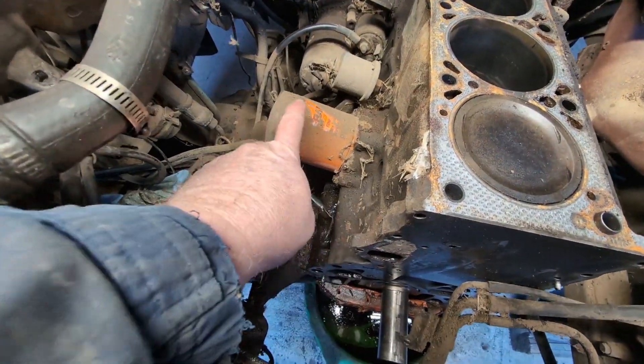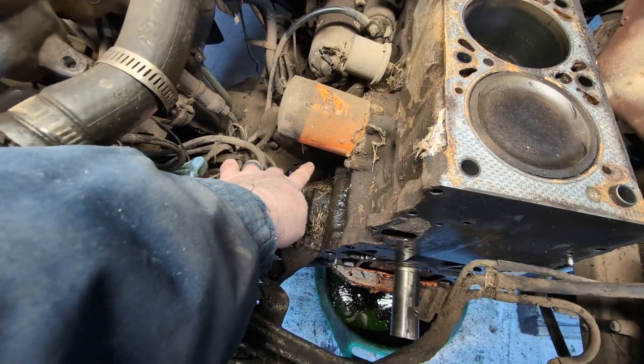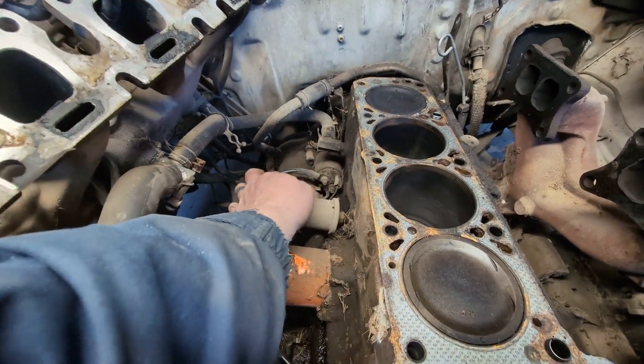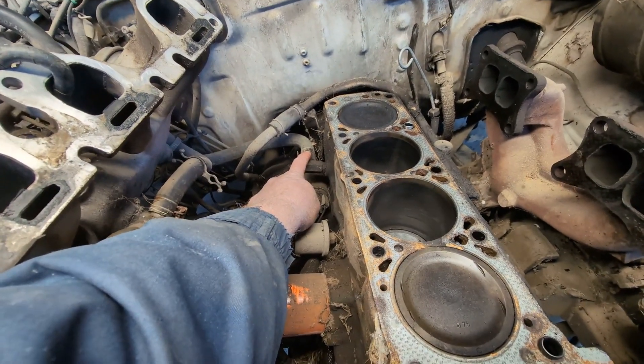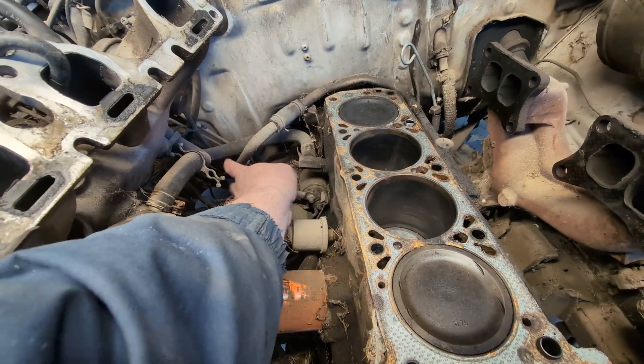What I'm planning on doing is taking off the oil filter, draining the oil, and that will make it easier to get to the motor mount underneath. I'll disconnect the wiring — I have the cable on the starter plus the solenoid wire. I'll have to undo this fitting that goes to the heater box and undo those parts.